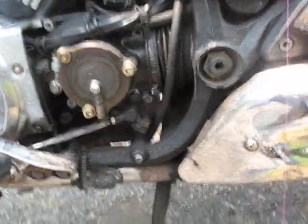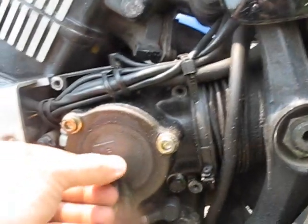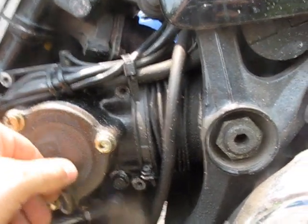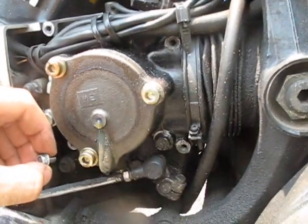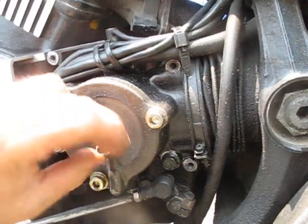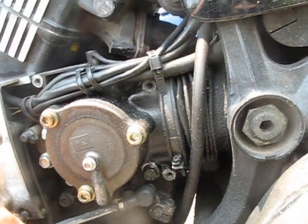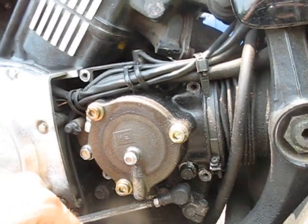First thing you want to do is make sure that you're not leaking any oil, even a little bit. I've already removed my cover plate here, and this is my sight hole on my bike. I'm just going to unscrew it. You see it dripping out like that? That means the level is being maintained — I don't have any leaks. You want to fill your secondary gear drive up to this level, and if it's still at level from the last oil change about 6,000 miles ago, that means you're in good stead.